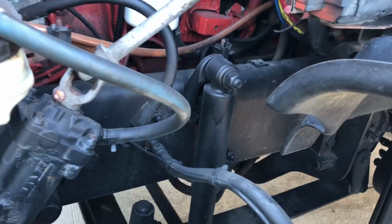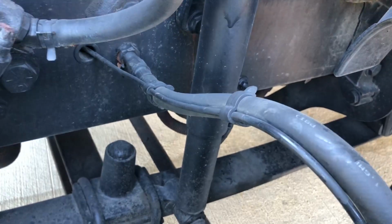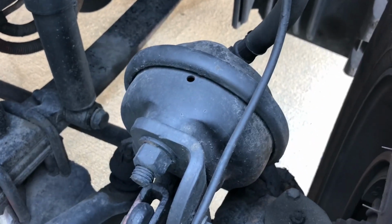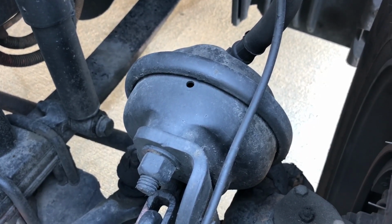We're going to come to our brake assembly now. We have our brake hose here. Want to make sure there's no abrasions, bubbles, cuts, or leaks. It needs to be in good condition and connected very well on both ends. From the brake hose, we're going to have our brake chamber here, making sure it's not cracked, broken, needs to be in good condition. The clamp needs to be nice and tight, and we don't want any leaking coming from our chamber as well.